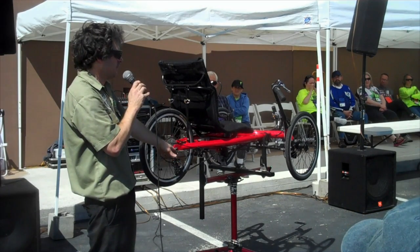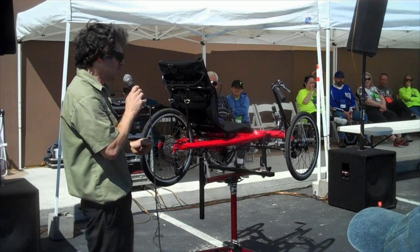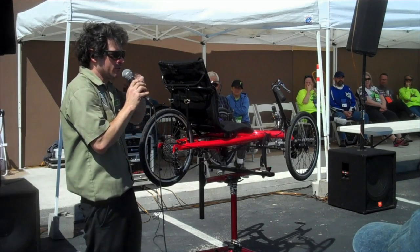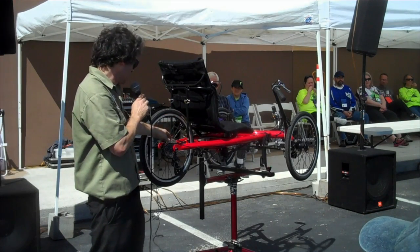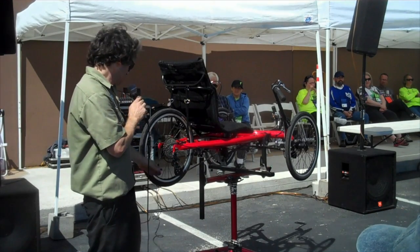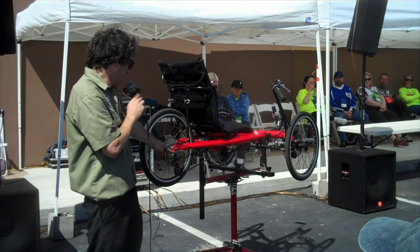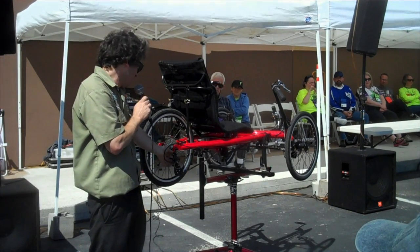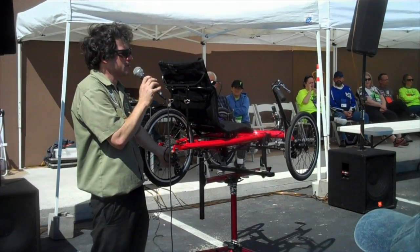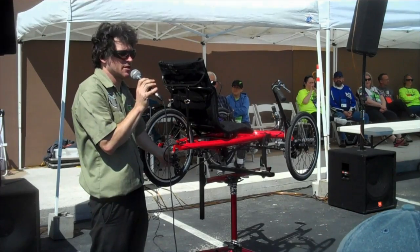If there was suddenly force on the chain, the bike fell over, or it got bumped while it was being shipped. Sometimes if the chain just hangs up and all your force of pedaling doesn't go into the wheel, it goes into the derailleur, and it can bend that piece. On steel frames like this, it was designed to bend. On aluminum frames, you tend to have a replaceable piece that can be straightened out or else just replaced. Usually replacing it costs as much as straightening it out.